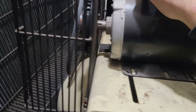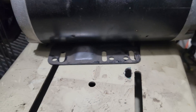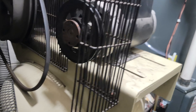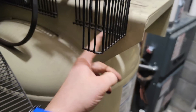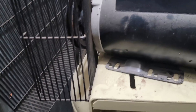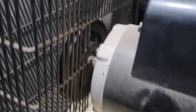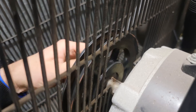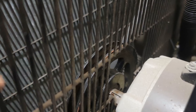The motor is free and the belt is off. You can see the hole I had to drill right here to fit this different motor frame. However, the vent grate is in the way, so you need to loosen the 10 millimeter bolts across the bottom at least a little to lift the motor out. The pulley is probably going to need either a puller or a hammer to get it off — there's no way to remove it easily in this state.